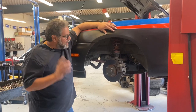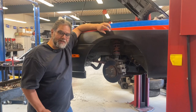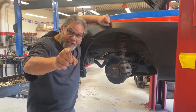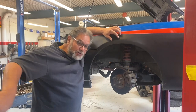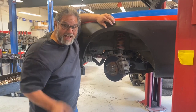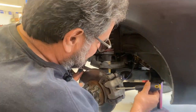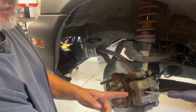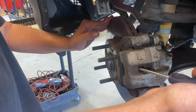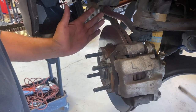The first thing I'm going to do - and I know this is going to blow you away, especially those of you who do brake jobs all the time - I'm going to push the piston back first, and I've got a secret way of doing it. I'm going to take a straight screwdriver and set it right in here in this slot against the pad and the rotor, and I'm just going to work that piston back. Check it out - the piston is going right back all the way. Once it's all the way back, that part's finished.